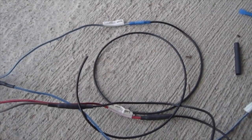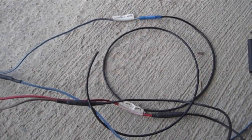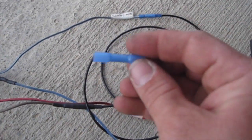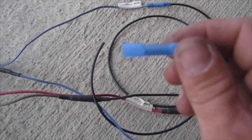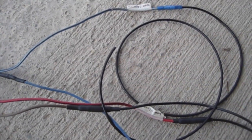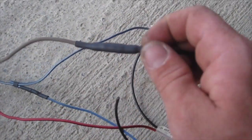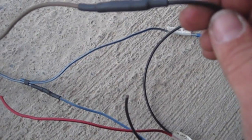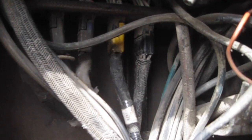The area in front of the front tires is a pretty brutal area for an electrical harness. To make my connections, I use butt connectors that have an integrated adhesive-lined shrink tubing built in. Before I crimp them, I coat the ends of the bare wires with dielectric grease, put them in the butt connector, crimp them down, and then use a heat gun to shrink it to get a good seal. Then to top it all off, I take another piece of adhesive-lined heavy-duty shrink tubing and cover the whole thing.